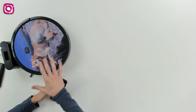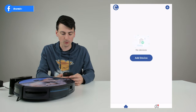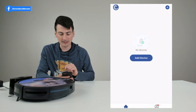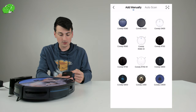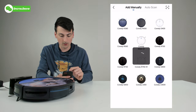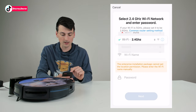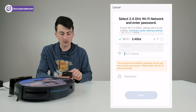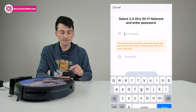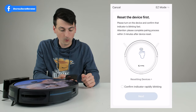Now let's finish setting this up. The vacuum is plugged in, powered on, and charging. We have the Cordy app downloaded on our mobile device. Once you sign in or create an account, you'll be at the home screen where you can add a new device. Select 'Add Device,' choose Cordy R400 as your model number. At this stage you need to make sure you're connected to a 2.4GHz Wi-Fi network — this will NOT work with a 5GHz network. Enter your Wi-Fi credentials and select Next.